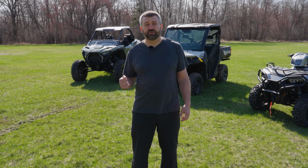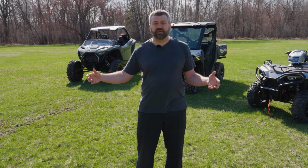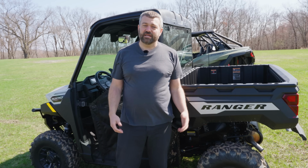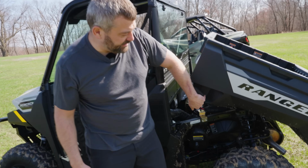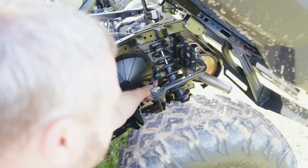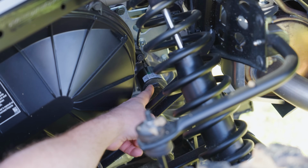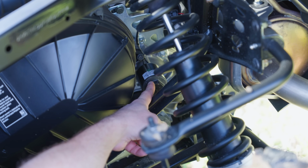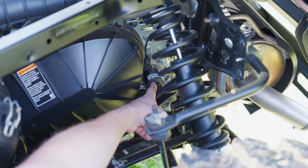Once you put it back in neutral or park, it's going to turn turf off and go back to that natural two-wheel drive state, so that when you're in park, the vehicle's not going to roll away because only one wheel's engaged. All right, for those of you that want a quick visual indication without turning the key on or looking in the cockpit, if a vehicle's got turf in the transmission, an easy way is to come down on the side. If you see this large black solenoid hanging out by your rear axles, that's a clear indication that your machine's got the ability to unlock that rear end and it's got the turf feature on it. You can also hear this thing click when you flip the switch down into the turf mode as it's pushing the solenoid to disengage the rear end.